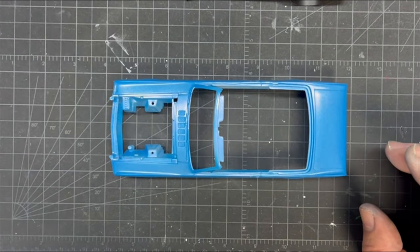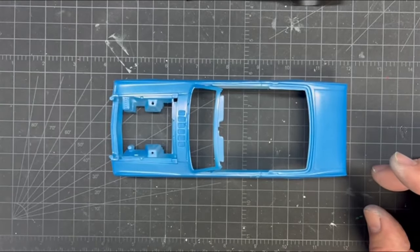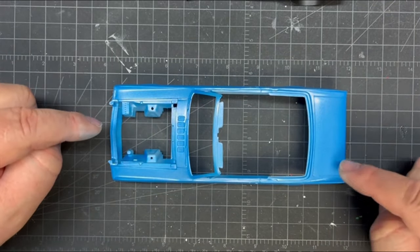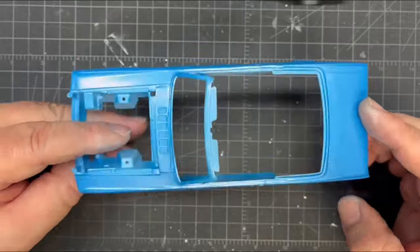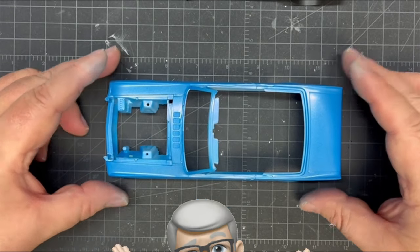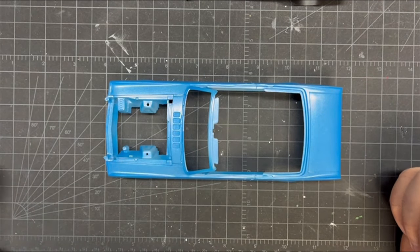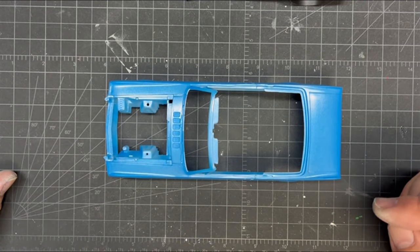Yesterday I used X14, and it sprayed well — everything looked good. I moved it off to the side and when I turned back around, the hood, the trunk, and both sides were all peppered badly. As soon as I saw it, I knew it was my fault because I washed this in Dawn, sanded it with 2000 grit sandpaper, and then didn't wipe it down with alcohol before going to the spray booth. I think a little bit of the releasing solution was still on it.